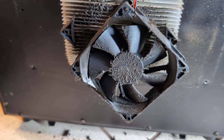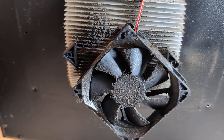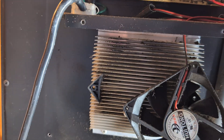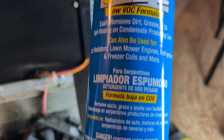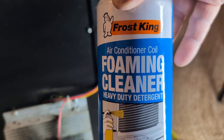We also need to remove dirt from the fans, because that affects their efficiency as well. The dirt on the fan blades slows the rotational speed and affects the efficiency of moving heat out into the air. If needed, we also have some foaming cleanser made for refrigerant coils that we may try.